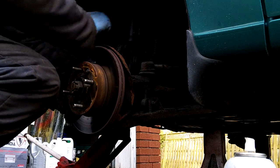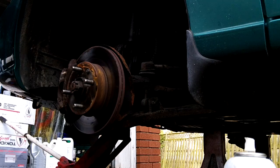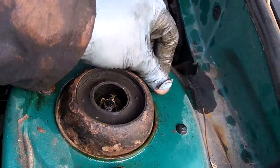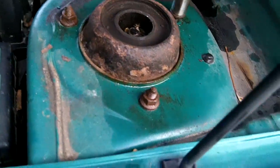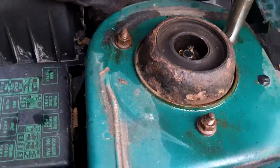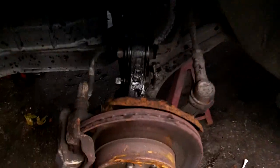And we're done. Now, the top bolts up top, tighten these again once you get the car on the ground and all the weight on them. You can tighten them now, but once you get the weight on them, tighten them and the center strut bolt again, because you'll have all the weight on the car and you want nice and snug. These top bolts, they're small, they're 12 mil bolts. Don't be tightening the crap out of them. It's usually where people have a lot of problem, is over tightening things. I rarely see problems with under tightening, it's usually over tightening. So, now we're going to tighten this up and move on to the brakes.